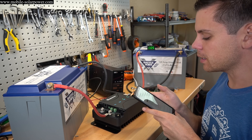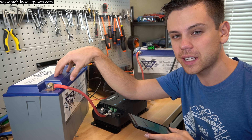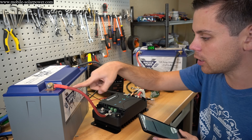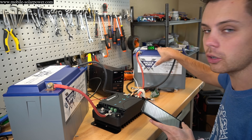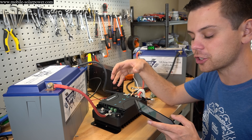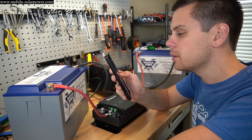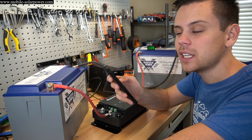After reading the manual: this unit is triggered by any voltage on the starting battery over 13.2 volts, at which point it starts charging the solar battery. If the starting battery drops below 12.7 volts it turns off. Solar charging is triggered when the solar input voltage is higher than 15 volts.